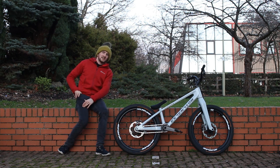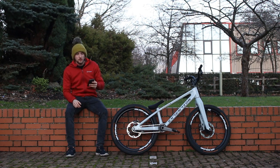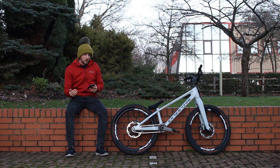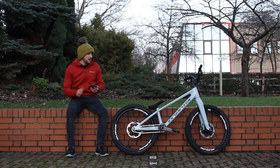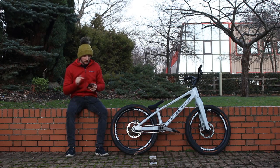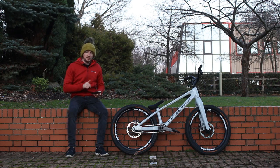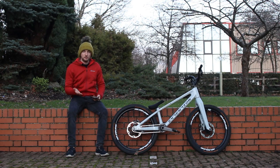The geo of the bike: the wheelbase is 970mm, the chainstay is 365mm — quite short. Bottom bracket is plus 15mm. Head angle is 74 degrees, so 0.5 degrees slacker than the Arcade, but works really well. Frame weight is 1350 grams, fork weight is 650 grams — very light. Fork length is 415mm. Post mount 180 both front and rear, so you could run a 180 disc bolting the caliper straight to the frame.